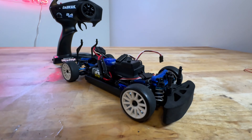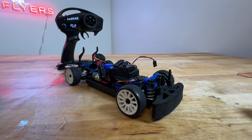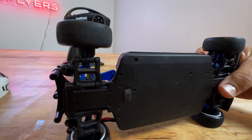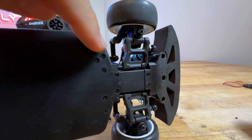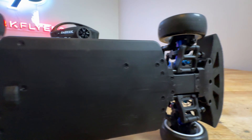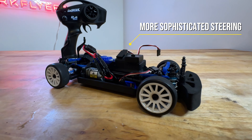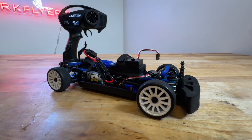The next thing: the car oversteers a lot because it's very small and darty — it drives like a toy. You want to dial out some of that steering and make it understeer more so it's more sophisticated. Thankfully, Traxxas gives you the ability to extend the wheelbase even on their toy. The front arms come pushed forward from the factory. On the rear, we moved the tab forward, which pushes the arms back, lengthening the wheelbase. Now you have much more sophisticated and better steering — it doesn't feel like a toy. You're dialing out all that oversteer and the car just handles and drives a lot better.